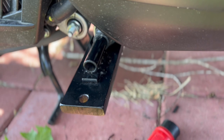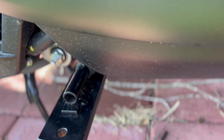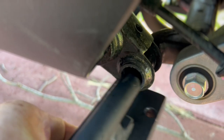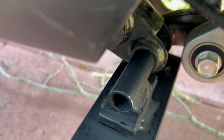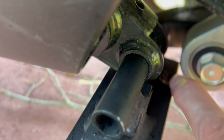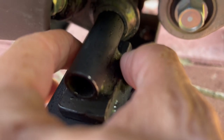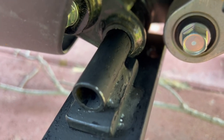Side A I have to send back to Topac because they made it wrong. I can't install it because it's not correct. Side A is supposed to insert right here in the connector for the swingarm, and when you go to insert it, it inserts okay. But when you try to put the U-bolt on, it won't go around the swingarm connector because they sent me a wrong-size one. This block of metal is too long — it should come to the weld here just as it does on the other side. I'm in contact with them, which just means this video takes longer to get up.